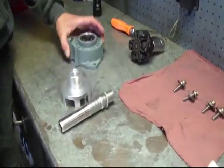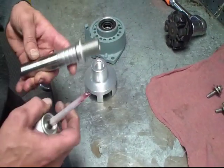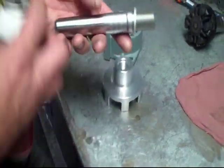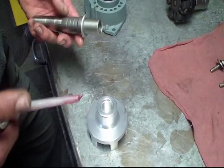Today we're going to press a mid-shaft through a mid-shaft housing. What I like to do first is make sure you've got your washer that goes on before the actual coupler itself. And I like to set the coupler on the shaft first before I press it through.